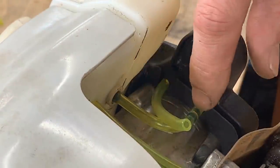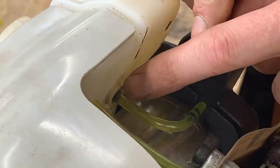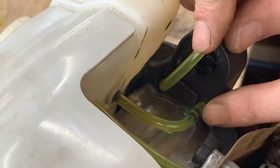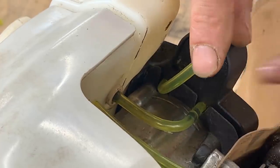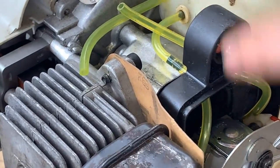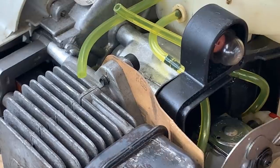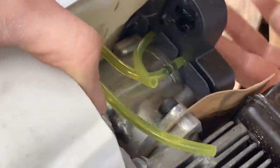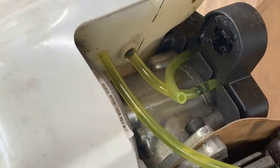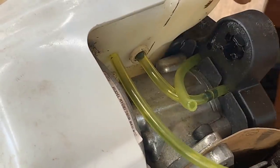actually reduce the size of the hose, because the new fuel filter is a little bit bigger and I needed to put a bigger hose there. But the other side where it fits the carb right here, if I have the same big hose that runs from there, it was too big for here. So basically in the middle I made a small connector, the same connector that we used before for this line. And